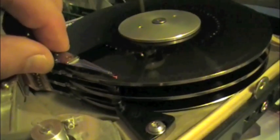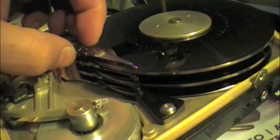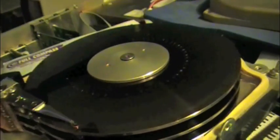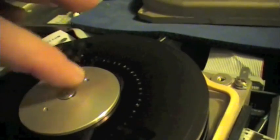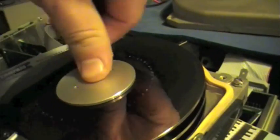There we go, there were metal shavings inside there. I don't know if you can see the damage to the platter there. That's the read and write head. It decided to break loose one day with a very audible pop, and then of course the result was that the heads made a physical crash down onto the platters there.